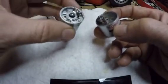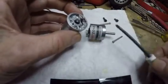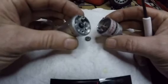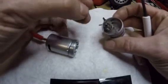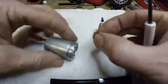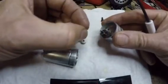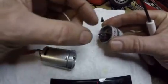Here's basically the can motor and the pinion, and then that's just the mount to screw this to the motor head. And then here's the gear head — inside of here there are 5 gears, and this is how they're getting the gear reduction. I don't know what this can motor turns at, but I'm sure it's pretty high RPM. You've got a whole stack of 5 gears on this side of the gear head. There's a little plastic spacer here that you need to keep — make sure you don't lose that. It goes on the last shaft to even out the length.